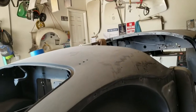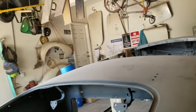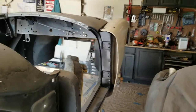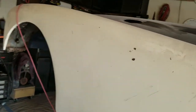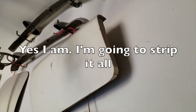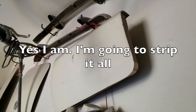That doesn't look too bad. The body, I thought at one point, was just a couple of days away from painting, which would have been a milestone: painting, well, repriming, prime sealing, which would have been a key to getting my fenders going. I need to wash these things. No, I don't. I need to strip these things. What I'm going to do is wash the doors here and here. And here's the thing. I'm not going to put a whole lot of effort into stripping the interior of the doors. I'm instead going to wash the hell out of them, scuff them up so that the paint is very milky, and prime right over it.